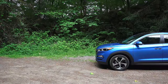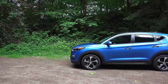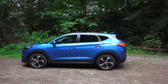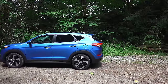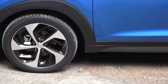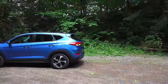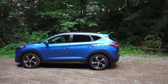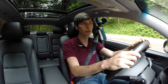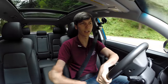The third thing: try not to spend too much time just inching forward. If you've got your foot on the brake and you're just slowly creeping forward, you're not going to be able to fully engage that first gear clutch, and because of that, you're going to have more wear. This is especially true if you are towing, or if you're going up a steep incline where you're going to have more resistance, or if it's just hotter outside. You want to try and minimize the time you spend inching forward, because the transmission is trying to engage that clutch but you don't have enough speed for it to fully engage, so it has to allow for some slip. These clutches are made for wear and tear, so it certainly can handle it, but if you're looking for maximum longevity, let a gap form in front of you, then move up and let the clutch fully engage so you don't have that slip and heat build-up within the clutch pack.